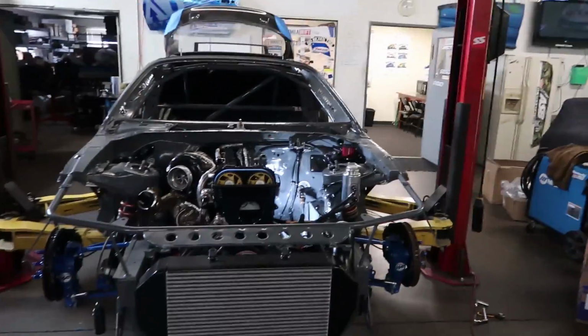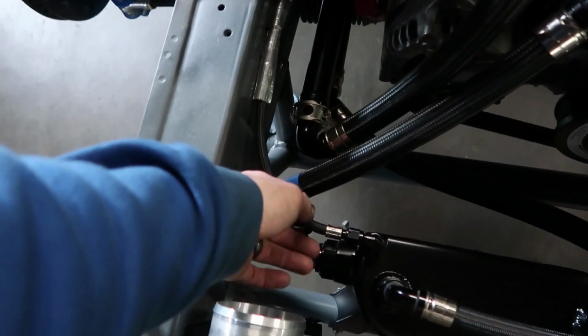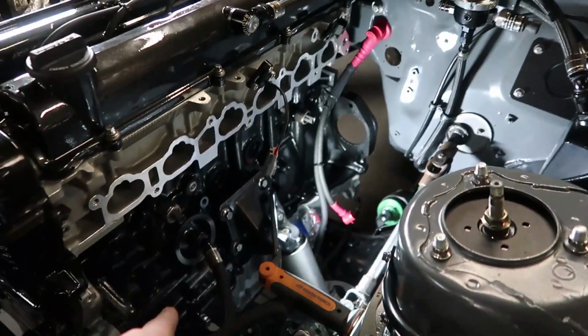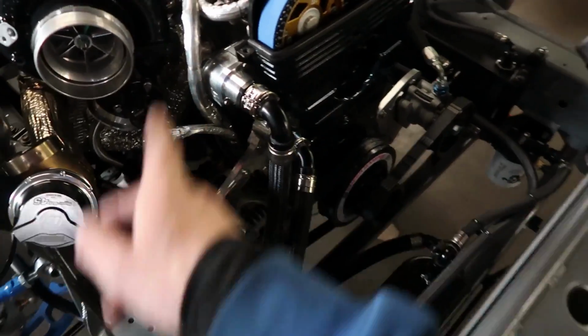Morning, everyone. So, today, it's Sunday. Look at this. Coolant hoses are all complete except one. I need an XRP-60 here. That's a 60. Got this situated last night with all the parts in here. Right now I was doing some ground wires. I put the ground on the back of the head, then I did the power wire on the outside and inside. I'll lift the car up now, do some zip tying and figure out this vacuum line that runs underneath the car.